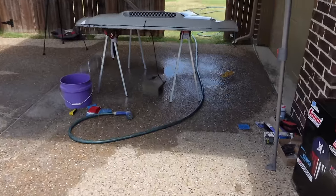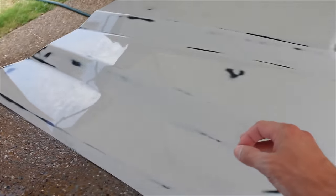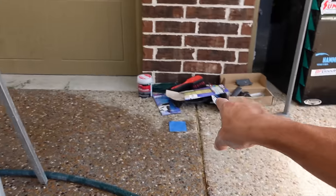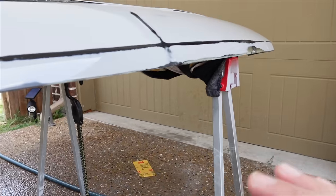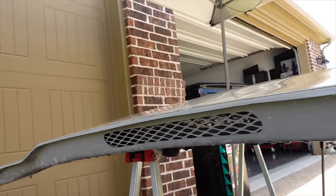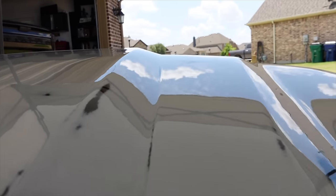Just for perspective, it is now 2 p.m. and I've just finished the first layer of sanding — 400 grit completely done. Everything is silky smooth to the touch. I was able to sand down some of these imperfections to the point where I only need the glaze putty — I don't need to touch Bondo again, which I'm super excited about. We also have this mesh which we need to sand down and prep for paint before we wrap as well. So we've got a ton of work still to do, but it is so shiny.